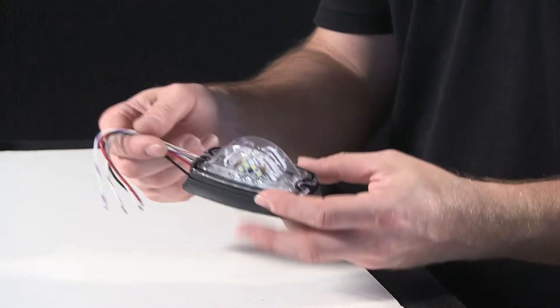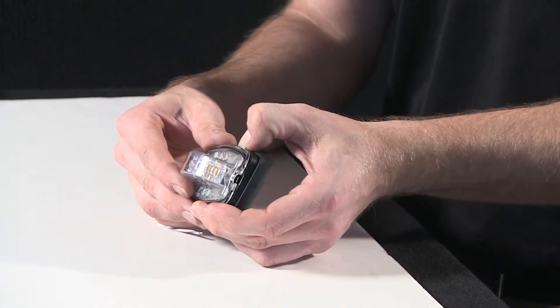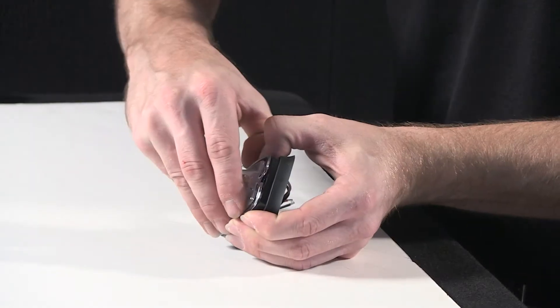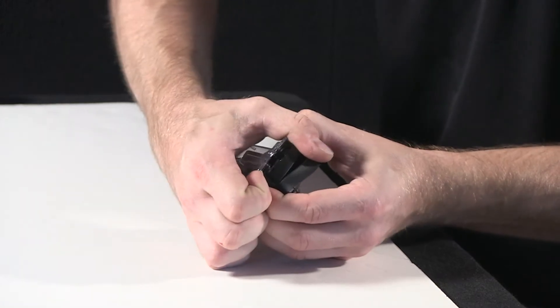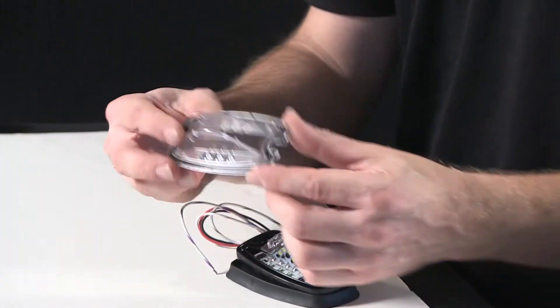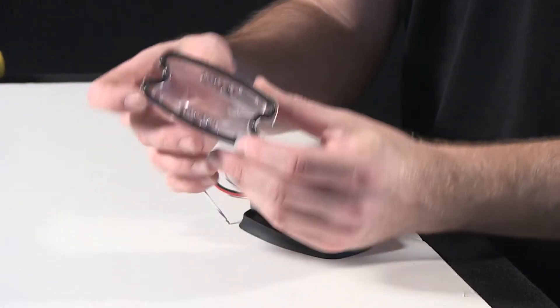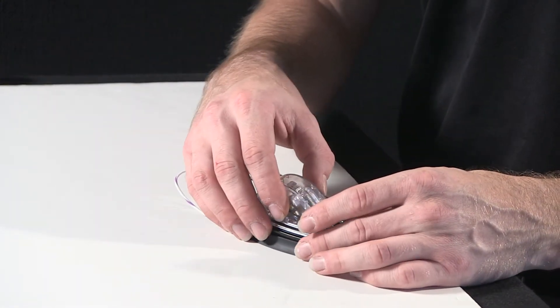There's a series of trigger wires, which I'll show you in a moment. The V-Series is a removable lens-based product. Should you ever have condensation build up inside the V-Series — which occurs from climate changes, warm to cold, cold to warm — the V-Series has a removable gasket lens. If you go ahead and slide a fingernail under the edges, you can start to free it. The lens itself has a nice, heavy-duty rubber backing gasket to keep it sealed into the V23 housing.